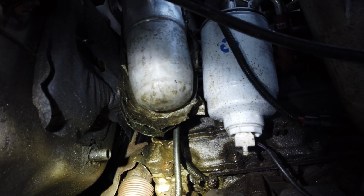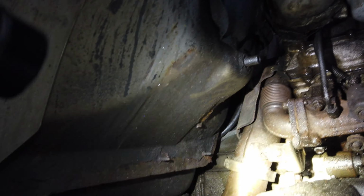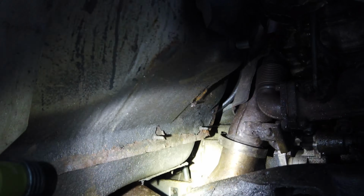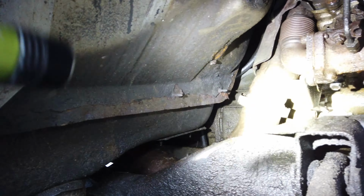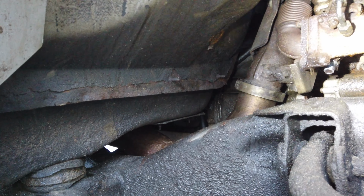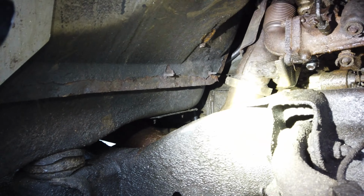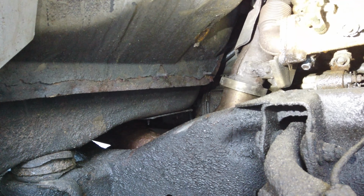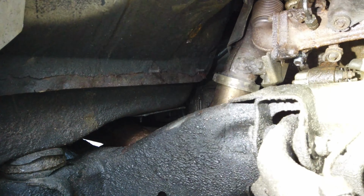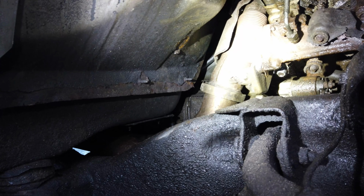But nope. Because the exhaust, actually, if you can see it right here, that clamp has to loosen up, and I have to disconnect the exhaust right there to get the starter to drop out of there. And then I will show you the process of getting the actual starter out of there. But let's get this exhaust disconnected, and I think that's a 10 millimeter or 11 millimeter. And we're gonna try to crawl on the ground under here on my creeper and see if I can get under there and get that exhaust disconnected.